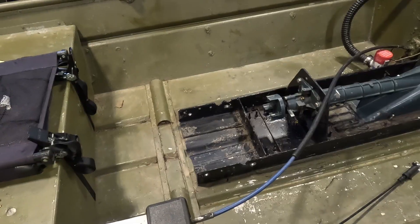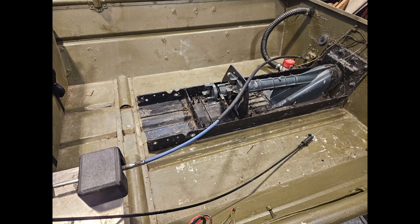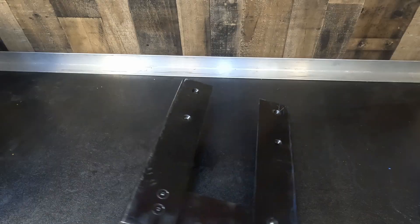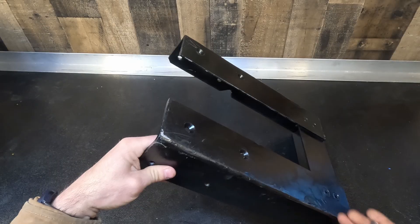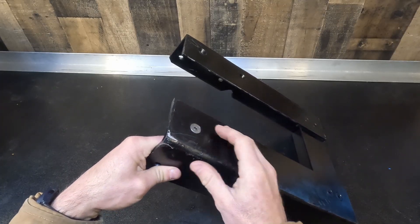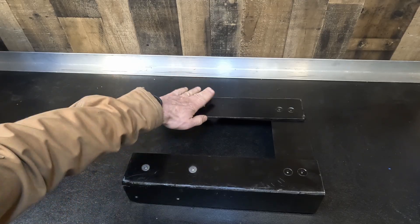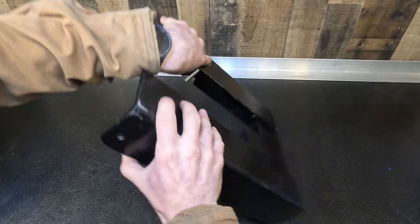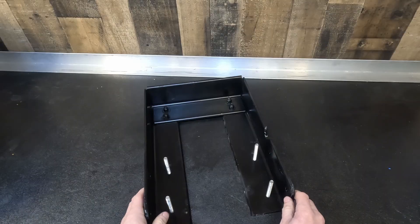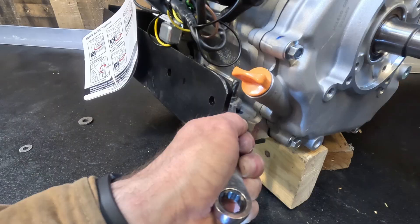With the 212 out, you can get a better look at the pump and engine mounting frame. For this prototype it was simply some aluminum angle — updated designs will be shown in the near future. Here's a shot of the 420 engine carriage, designed to fit into a tight clearance using tapered bolts. Since the WaveRunner 500 pump shaft is about a quarter inch above the 420 shaft, the engine carriage is about 3/16 aluminum. This cradle provides just enough room to mate the shaft heights.